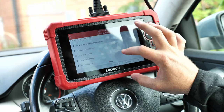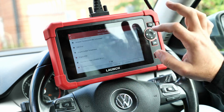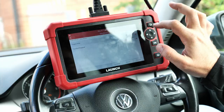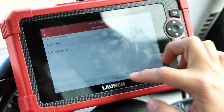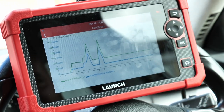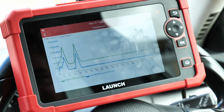This is a very capable tool — I absolutely love it. Of course you also have the data stream. Let's pull up fuel rail pressure and engine RPMs and see how it handles that. You can see them in a graph — start it up. You can combine both of them and view them together. It shows the legend clearly with green and blue lines.